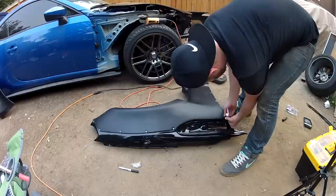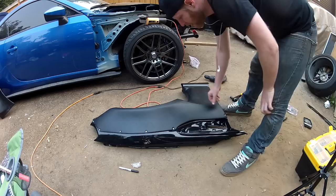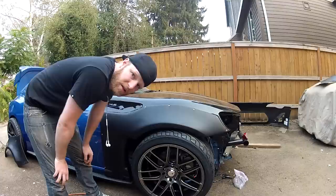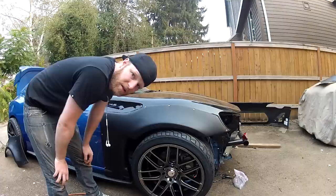We've got our flare on there just resting on a bunch of different rivets. The rivets that came with my gun happened to be a little too shallow to go through the thickness of the plastic and the metal, so I'll pick up better ones tomorrow. Just so we can test fit, I'll throw this back on the car. You can see it looks pretty good, but clearly the wheel spacers in the front are a little overkill. I'll order smaller wheel spacers for the front, keep the size running on the back, and tomorrow pick up some thicker rivets. Same process on the other side.